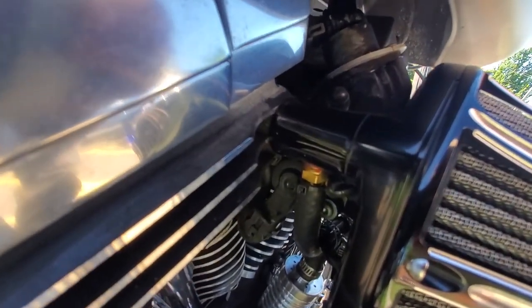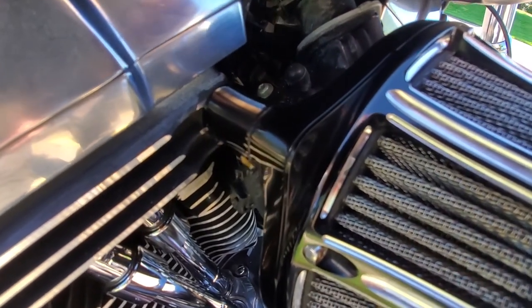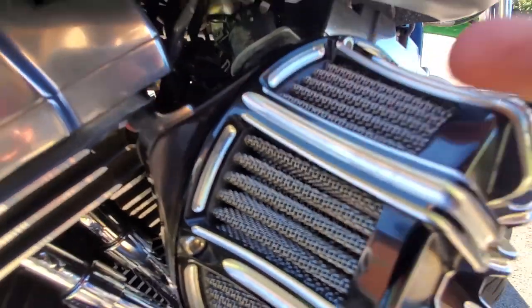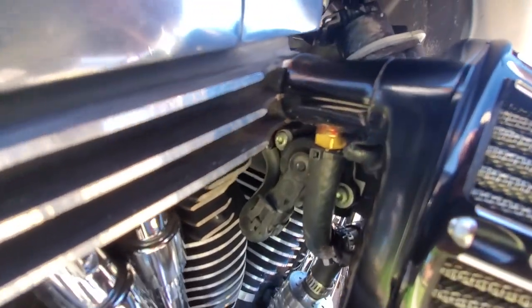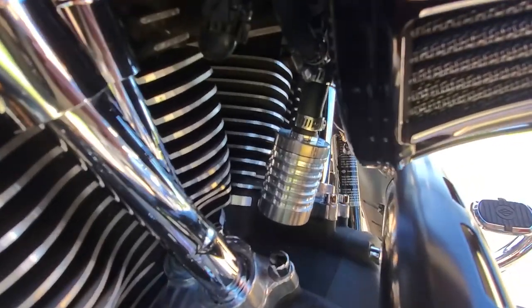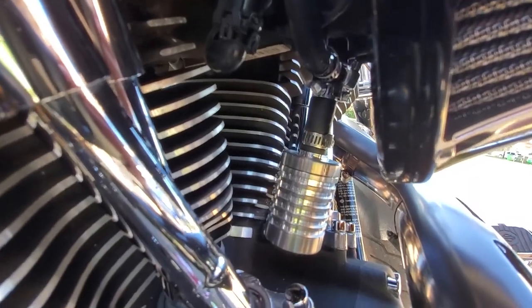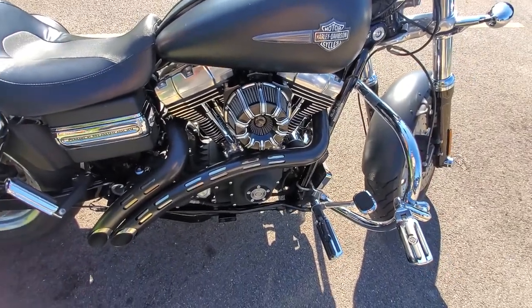in line where those brass fittings are, because normally those banjo bolts would go into the inlet tubes of the breather, but I have those sealed off now with some Permatex, and now they're capped off right to where those brass fittings are. And already I've gotten some espresso coffee mixtures inside the oil catch can, so it's definitely doing its job, which I'm pretty happy about. Other than that though, it seems to be set up pretty nice.